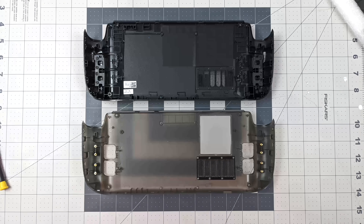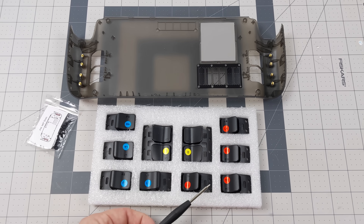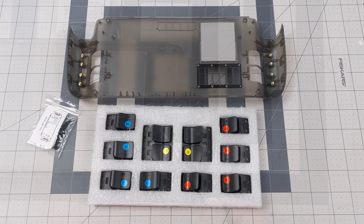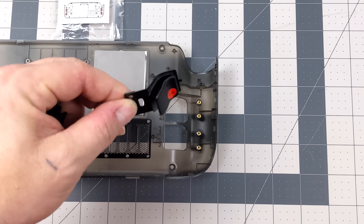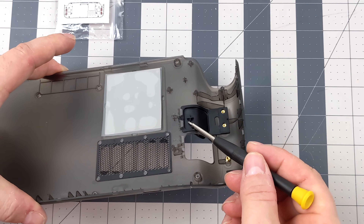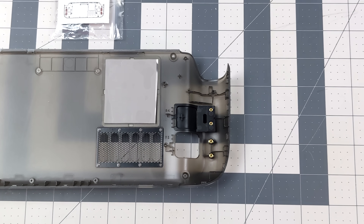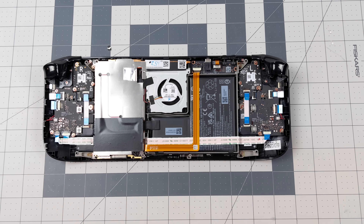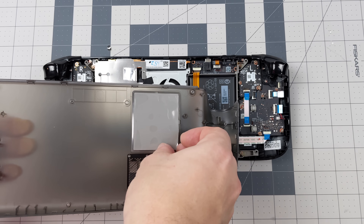I think they did a great job designing this rear shell. The first thing we need to worry about are the rear buttons — I think I'm going to go with the red ones, which are the high ones, but you could experiment. You could go low or stock, and it should be easy to test them out before fully assembling the unit. Getting them in is quite easy and there is a little ridge that this needs to go underneath — if you leave it on top you're going to have a gap in the Steam Deck's rear shell. Once it's mounted we've just got a little bit of play to push that rear button. I'm going to get all four in using the included screws. Once that's finished, the last thing is to reassemble the unit. Remember we've got that aluminum plate with the thermal pad on the clear shell — make sure you remove the protective film on that thermal pad.